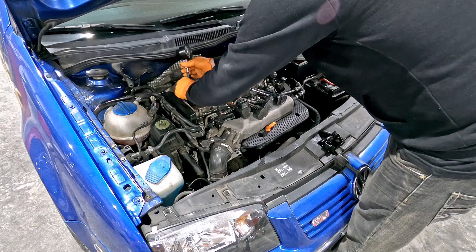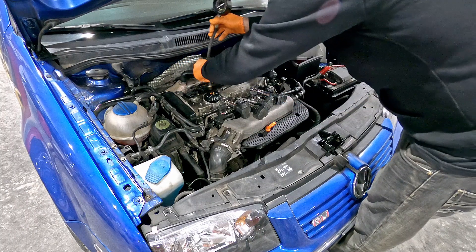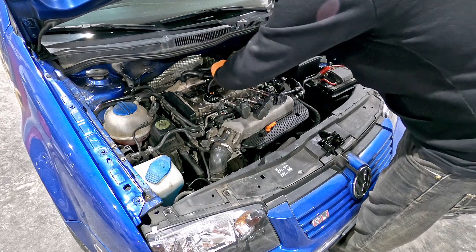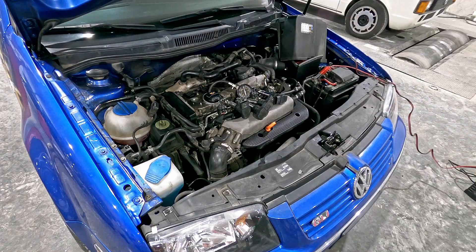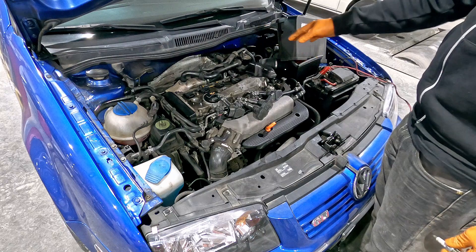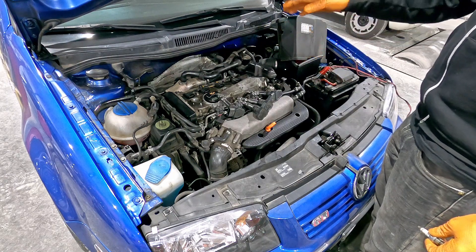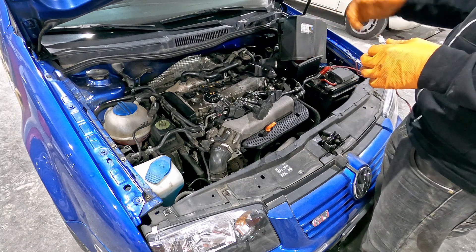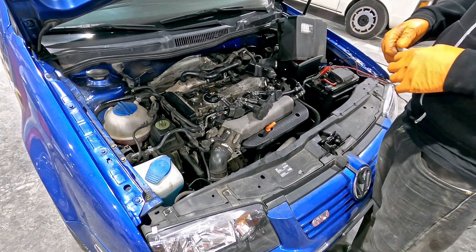170 — that's basically where I'd expect this to be. I've gone through and tested each hole multiple times to make sure there were no anomalies. Everything is between 160 and 170, which is what I would expect. The cylinders aren't that far off from each other. I'm basically going to thread the plugs back in and then start tearing the car apart.